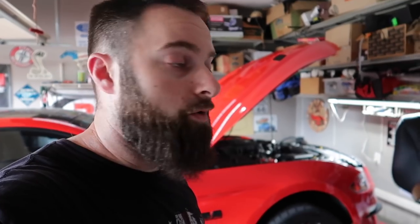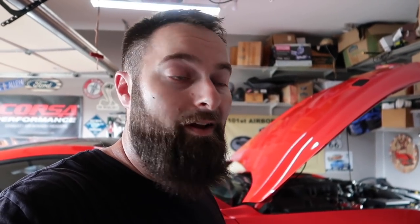For all of you guys that actually build engines out there, let me know what you think. Any red flags? I think we're in good shape. That's going to wrap up the video — successful oil change. We won't touch it again for another 500 miles. Once we cross that thousand miles, we'll put the good 5w50 weight engine oil in it and then it'll be time to take it to the racetrack. I appreciate you guys watching. Take care, have a great day. God bless you, until next time.